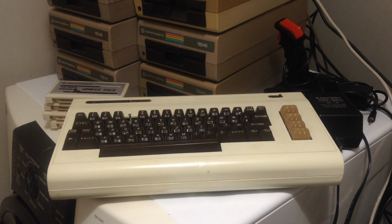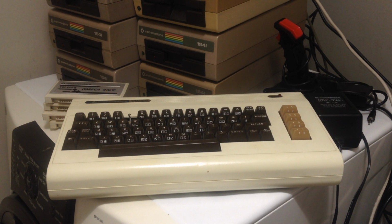The number 4 key is missing. It has been replaced by a tiny screw. So definitely, even if this machine works, the keyboard's got to come apart, and a replacement plunger, stem, whatever, spring and keycap have to go on there. They do. This is a 2-prong version.